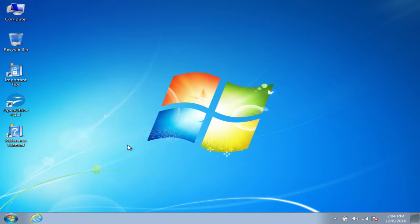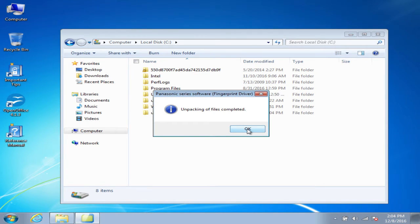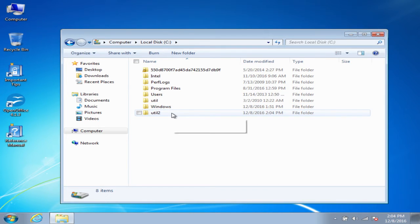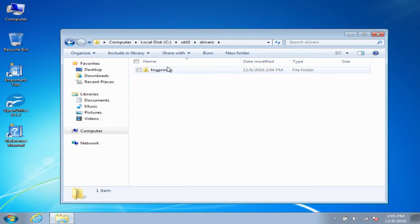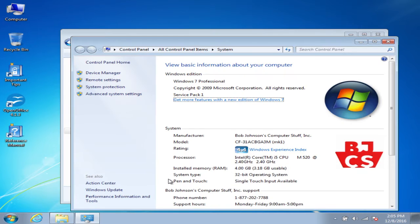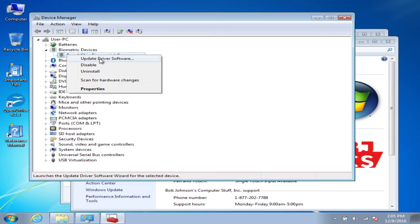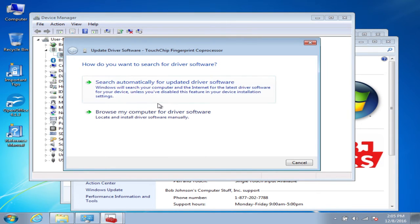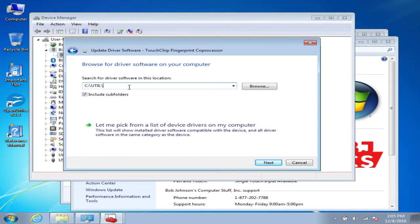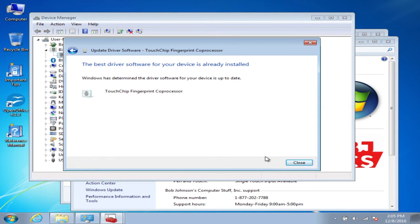Click OK and give it a moment. It'll pop up and tell you when it's done downloading and when it's done unpacking the files. Once it's done unpacking, go to the folder location. If you need to install the drivers, you'll have to go into Device Manager and manually install them by right-clicking the device, clicking Update Driver, clicking Browse My Computer, and navigating to the folder that the software is in. It'll automatically install the correct driver.